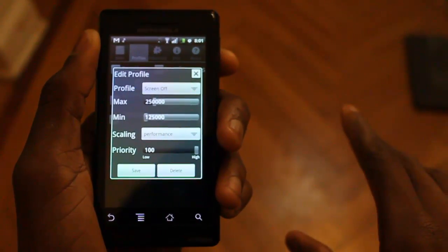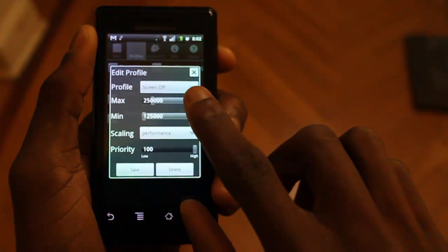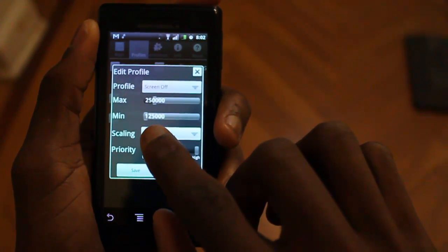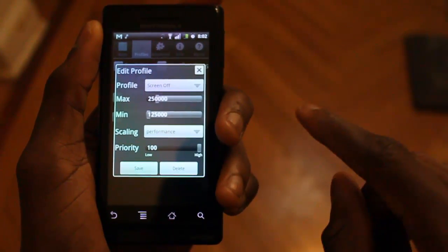There is not much else you can do, and if anyone else has gotten such long battery life with any other methods, please let me know. But what I do is when the screen is off — so for example when I just turn the screen off like this — the processor really underclocks. It's underclocked to between 125 and 250 MHz, scaled way down from the stock 550 MHz.